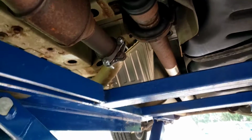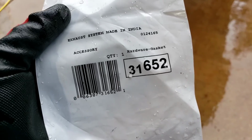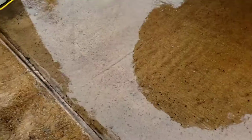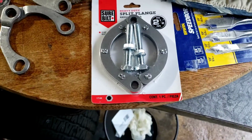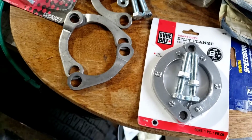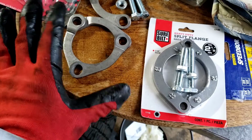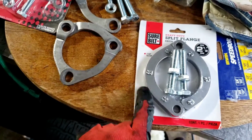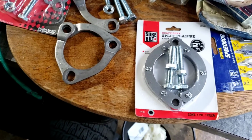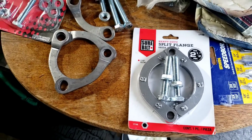Alright, let me see if I still have that number for the gasket. Let's get out from the rain. Alright, this is the gasket I use, 31652. Alright, and that's it. Like I said, I usually use the dual bolt split flange, but they only have one in stock. Otherwise, I use this. Works just as good. The 3-flange one is a little hard to use on the dual flange because it's a little wider over here. But you do what you can, right? It works. That's it. Thanks for watching.